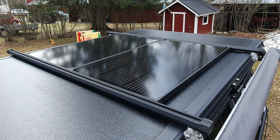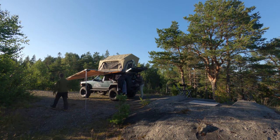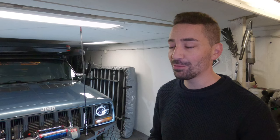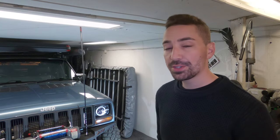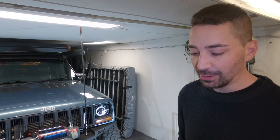Considering the sun's behind a tree and clouds are in and out, and the angle of the vehicle is quite bad — if it was pointing directly at the sun we'd see a lot more. Well, there we go, another big job done on the Jeep. A couple of days on, I've had it out in the garden between work and the most I've generated from the panels with the tent open pointing directly at the sun is 189 watts — probably could get a little bit more out of it too. Any power input when the vehicle is stationary is a huge bonus. We've had to leave camps in the past because the fridge was using a lot of power and we didn't want things to go bad on a week or two on the road. I'm mounted just below the roof bars. There's a slight cutout on one side that looks a bit rough — I'll get a rubber grommet and pop that in. Just got to get that new turbo in and it's ready to roll. Camp is packed and the turbo should be here next week.